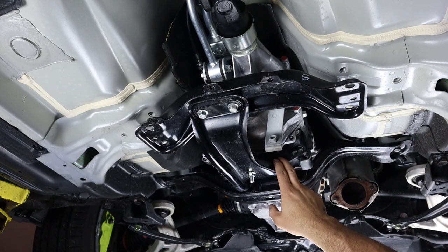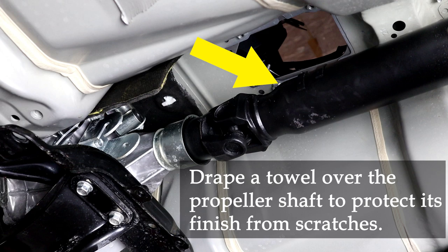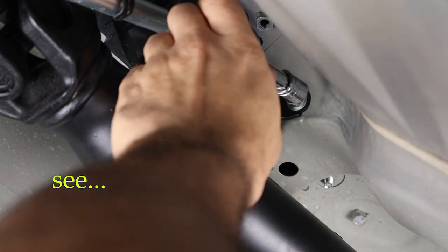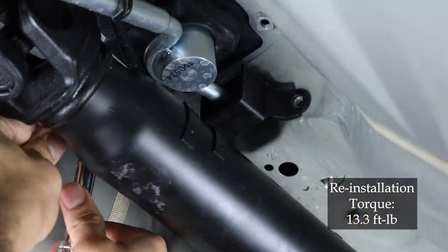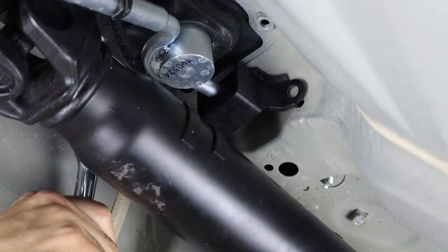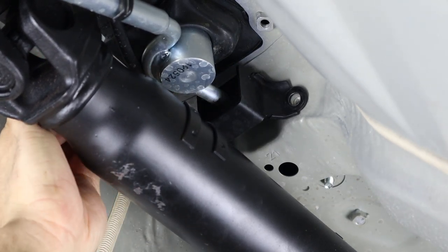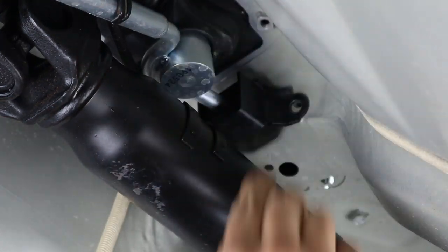I just wanted to point that out since all of this is taken apart. We're almost there, and although you don't see me doing it, I would highly recommend draping a towel over the propeller shaft to protect the finish, since you can scratch it up with the metal parts of the shifter as you work it out of the car. Here we have to remove this shifter bushing, which is held in place by two 12 millimeter bolts. This is also a part you can upgrade to firm up the shifting experience, or if your car is older and the shifting has become loose over time, there's a good chance this bushing can be worn — now you know how to get to it if you ever wanted to replace it.